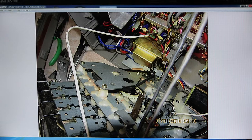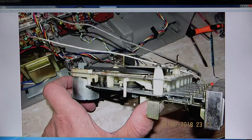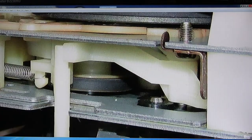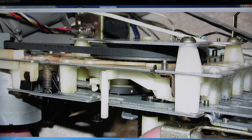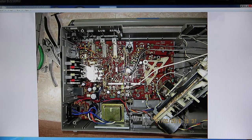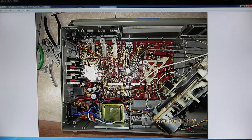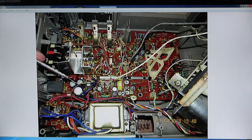Finally got the tape deck out - only held in place by three screws. And that's just how the belt's routed. This has just one belt, and geared and idler tires. So here's an idler tire here, and then here's the other idler tire right there. These were good - still work. And the belt was still pliable, so I left it alone.